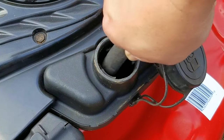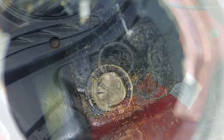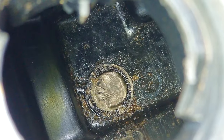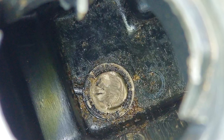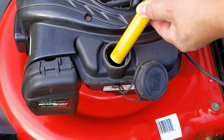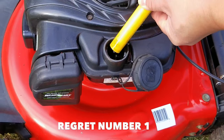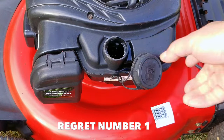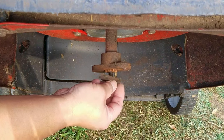This repair was a series of regrets, and I'll let you know what should have been done instead. After using the shop vac to try and clean out the tank I was able to get the larger pieces out, however I didn't get it all. What I should have done was take the tank off the mower and rinse it out instead. Doing it that way would have gotten out the rest of the debris, because what's left in there could pose an issue for the carb.